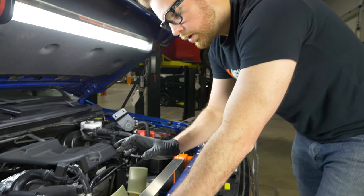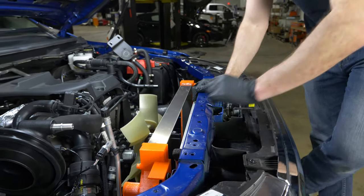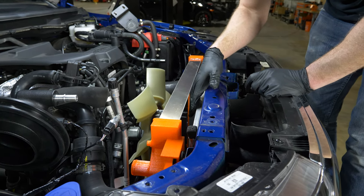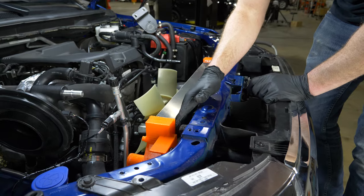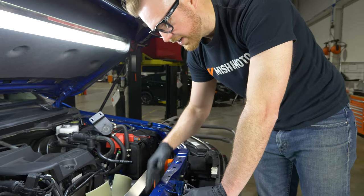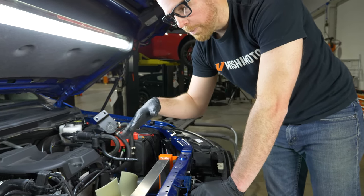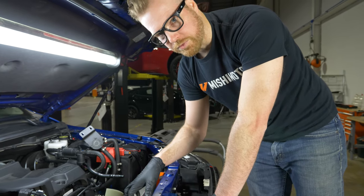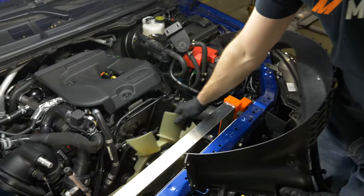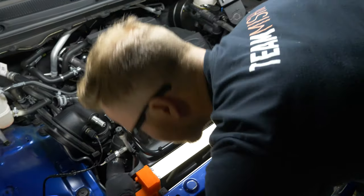Now with those changes — making it thicker, making it taller and longer — you could run the risk of running into things that are around it. So you have your AC condenser, which lives up front here. What I'm looking for is to make sure that there's no rubbing between the AC condenser and our header plate on our end tanks. I want to make sure that all of our gaps between the AC condenser, the intercooler, the fan shroud — we want to make sure all those distances are the same as well, because all of those things are going to impact how this rad performs. It's not just the size of the rad and the design of the core; it's also the surrounding components that impact the performance of these more modern radiators in these vehicles.